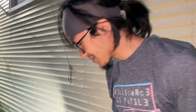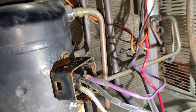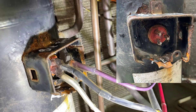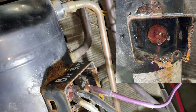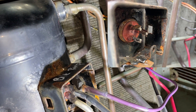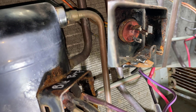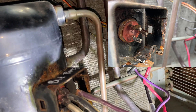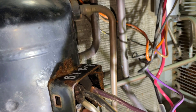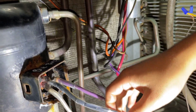It's been about an hour since the last clip and we jerry-rigged everything to work. The way the prong looks is there's a circular pin coming out with a rectangular-shaped wing coming out from it, which is really hard to fix a wire to. What we ended up doing was coiling the wire around the cylindrical pin behind the wing, so if it tried to get pulled out it would catch on the wing. Then we put heat shrink on it to hopefully reinforce that.